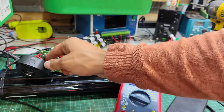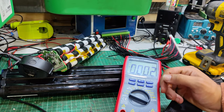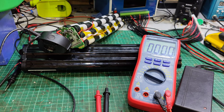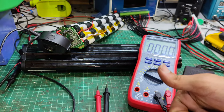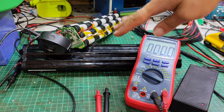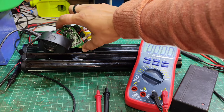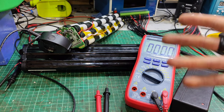To wake up these BMSs, feed it a little bit of power backwards to the board — seems to turn it back on. Don't know why it was off. I've got no backstory with this battery at all, just that on the side case it says 'needs new BMS.' But it's charging. I will have to go through all the health checks of the battery — see when it cuts off, what voltage that is, should be fine with a 42 volt rated charger. See when it discharges to — is it 30 volts? Because if this happens every time it discharges, the BMS is still knackered and needs replacing anyway. If you can even get one of these — it's a very odd shape. I don't think a regular generic rectangular one would fit, but we shall see.